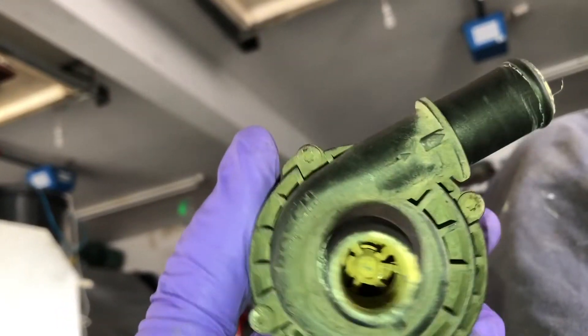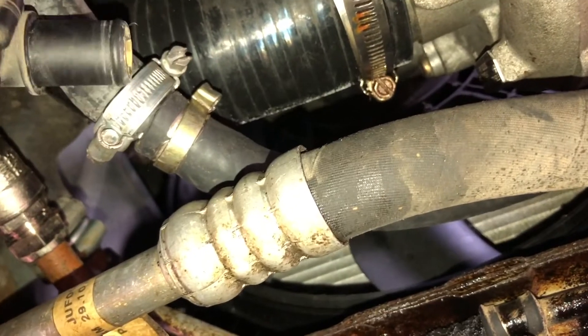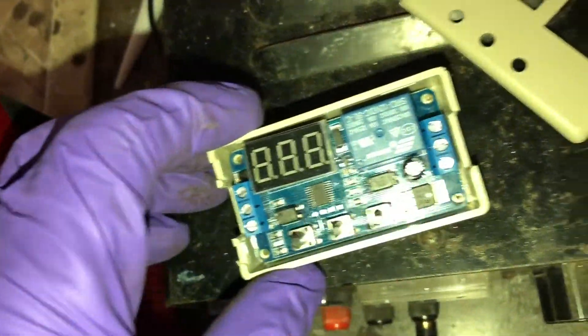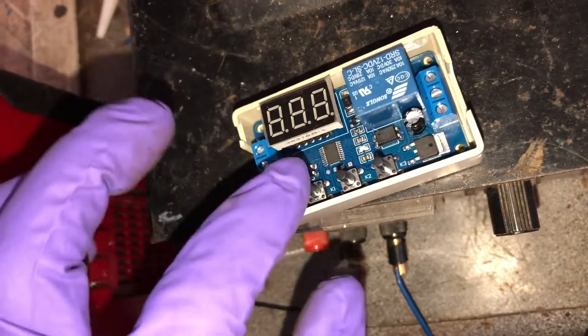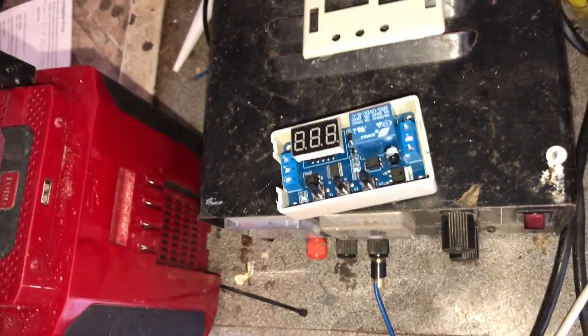Quite easy to use. I'm just going to interrupt this pipe and put in an auxiliary water pump. I didn't want to spend a lot of money — I got this one from eBay for £12. It does work. It's from a Renault Scenic 1.9 diesel. It rotates okay. You can see the direction of water flow by the arrow. All we've got to do is have it pumping out to the turbo. Attach this pipe, connect this one onto here, that one onto this one, and then plug it in and have a little circuit. I managed to get this little timer module fairly cheaply from eBay — it's £11 including postage and including this nice little case. It's a digital solution using a little microcomputer chip with some presets for different delay modes.